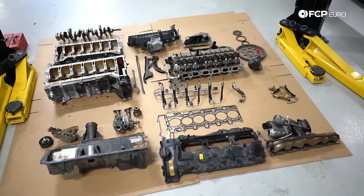So it's pretty evident based on the condition of the connecting rod bearings and some of the main bearings that there was a serious oil problem on this engine. Whether that was because of a bad oil pump, not enough oil on the engine, we'll never know. Another thing that we've seen on a lot of N55s now, it's kind of untalked about. There is a service bulletin from BMW that talks about priming the engine after a major repair. So VANOS sprocket repairs, oil filter housing gasket replacements, oil pan gasket replacements, oil pump replacements, pretty much anything other than an oil change that involves opening up the lubrication circuit. BMW says to prime the engine 3 times for 10 seconds. And from my understanding that actually comes from N55s seizing up in the shop after those repairs.